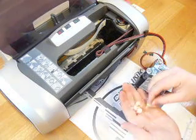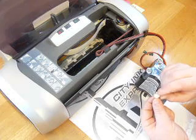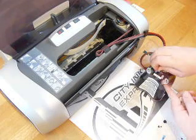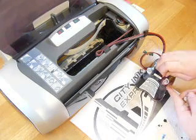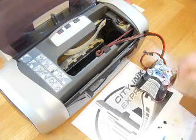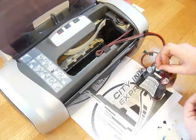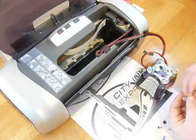So the air filters themselves, it's a one-way air filter, so it has a narrow pointed end and then a short fat end. So you need to remove the small flat plugs, like so, all four of them. Two, three, four, and then you need to install the air filters with the fat end down, like so. Just click them into place, like so.